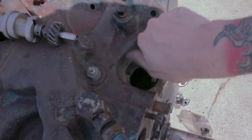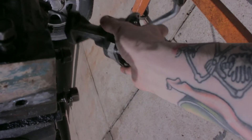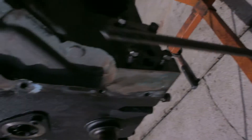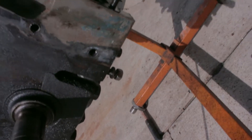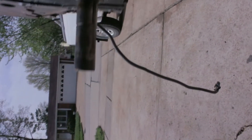I've taken the oil pan off the bottom, which is also self-explanatory — you just take the bolts off, hit it with the rubber mallet, and it falls right off. Up inside, hanging down off the engine, this oil pump just hangs down underneath here and the pickup goes down to the deep part of the pan. That arm coming off the oil pump goes up through a passage in the block and connects to the distributor. It's not uncommon when you pull these pans to find dropped rods down there — I had one that I had dropped.